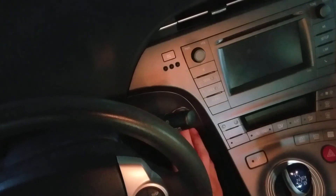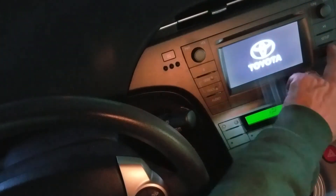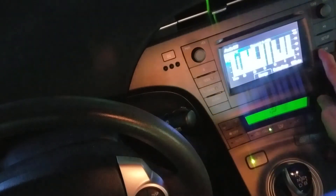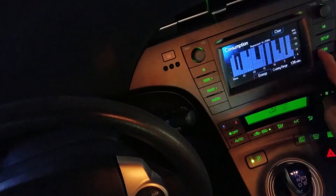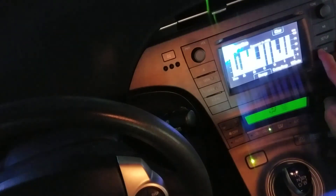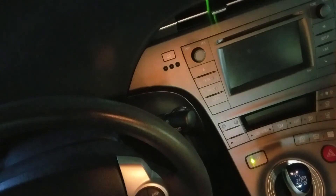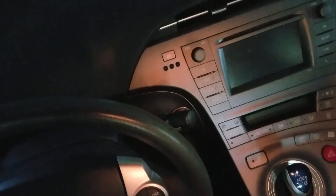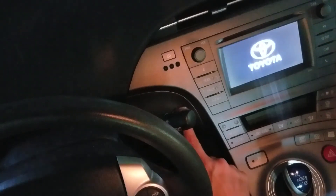When you're finally done, just hit the power button — it turns off everything. And the next time you turn on your car, your display will be normal. Now, if you follow this procedure and it's not working for you, slow down the steps. I discovered that if you turn the headlights on and off too quickly, it doesn't register with the computer and it doesn't take you into the service menu. Just slow down the steps and you should be able to get into the service menu.